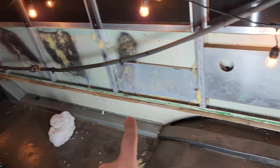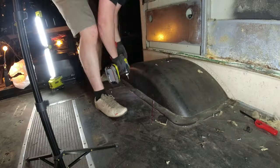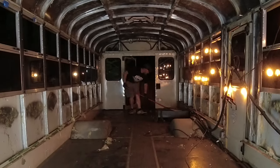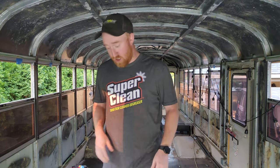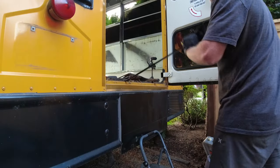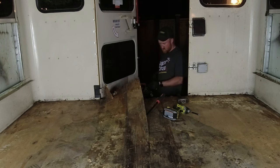I have to take off all the metal sheathing for these heaters here - the heaters I'll have to unbolt, but I don't think I'm going to be fully removing them yet. Now it's just getting the rest of this off and then cleaning the entire floor. There are thousands and thousands of screws that were taken off of these panels - the ceiling, the floors, the seats, everything. We are now down to the last stage of the gutting of the bus: the floor. The big thing is I do not know the condition of the wood underneath, other than I can feel a few soft spots. So I do not want to keep this plywood. I'm going to start at the back, pry it up a little bit, take a small floor jack, shove it under there and use the jack to pry it up - that way is supposed to be a lot easier.